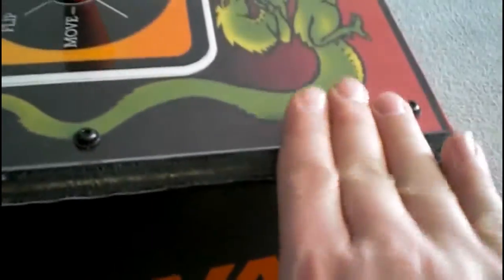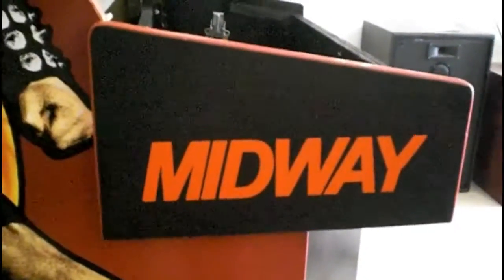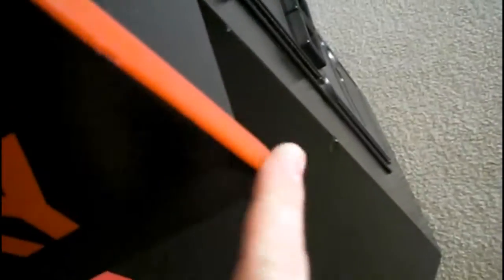I got this side applied. You can see I've got a little bit left over here. What you want to do is slit your corners, take your decal and fold it over. When you fold it over and put your T-molding back on, it will protect it from getting pulled off. And here's the left side complete — it's all tucked underneath, T-molding is back on. Turned out absolutely perfect. It doesn't hang over anywhere, so there's no possible way to catch it and peel it off. It's hidden underneath the T-molding.